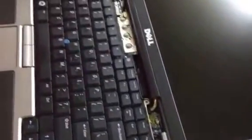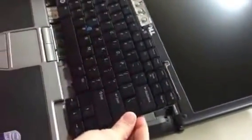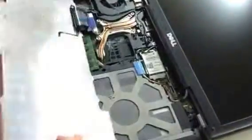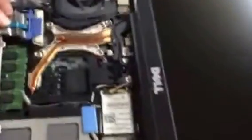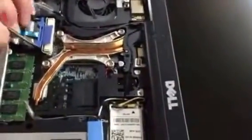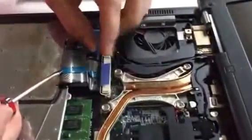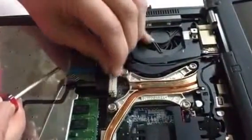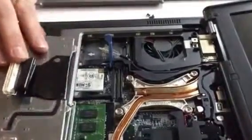You'll note our skilled operator doing this operation in a very short period of time. Now unsnap the keyboard and lift it up gently, because the only thing left holding it is the flexible circuit. So with your flat blade, pry loose the plastic cover that holds it on, and then you'll see another cover that you unplug. It's as simple as that.